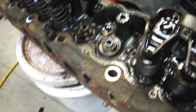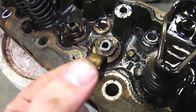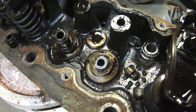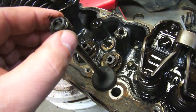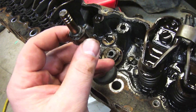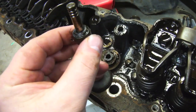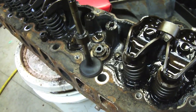I feel like crap so I'm not going to spend a lot of time on it. But these here are your valve guide seals, and these go over top of here. So if you're having problems with smoky exhaust and burning lots of oil, it is very possible that your valve guide seals are leaking — because this is what stops your engine from sucking in oil. There's a rubber ring around there that basically acts as a wiper to prevent oil from leaking down into your cylinder.